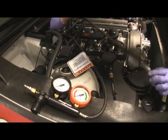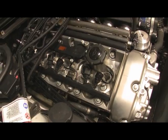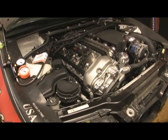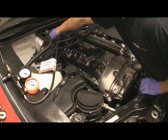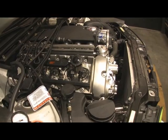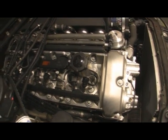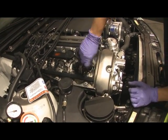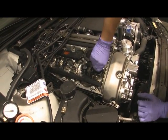The reason we do a separate leak down test is because often on cars like this with the M3, the piston ring lands are weak. What happens is those ring lands can sometimes break, but the engine will still hold compression. With a leak down test, we pressurize the cylinder with our own air, and if the ring lands are cracked, the air will escape and we'll be able to observe the leak. That's the way you can find broken ring lands even though the compression checks out.